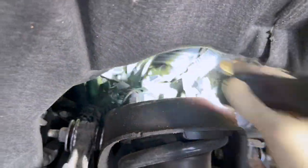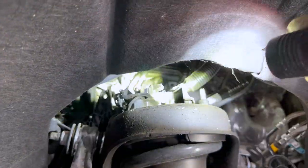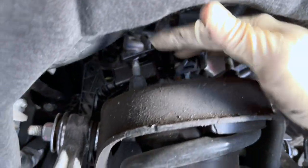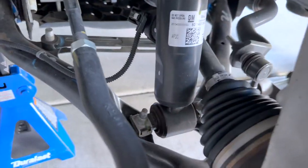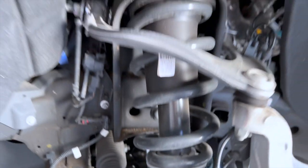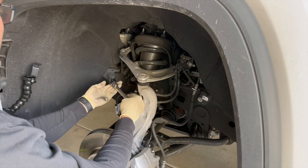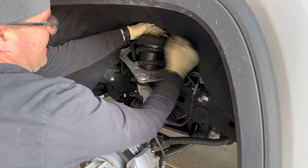The whole plastic wire harness adapter needs to come out. There's a little cap here that comes off with a trim tool — just pry it up. Once you get both those little retainer caps off the stud you can push the harness back and get access to the three strut mount bolts. Then there are two down here holding it to the lower control arm. The strut mount bolts are 18mm — I'm using a ratchet wrench with a flex head, much easier than trying to get a socket on because they have a stud.